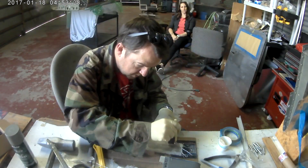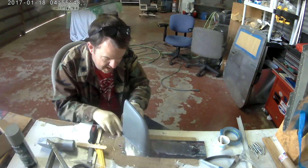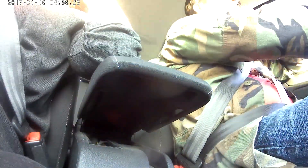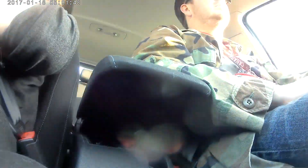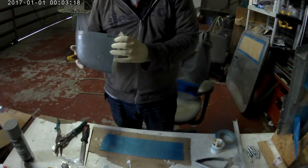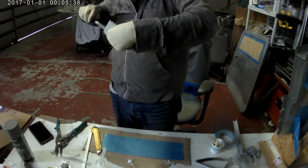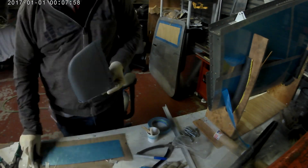After you're done putting that initial piece on and it's bonded to the fairing, you need to reinforce it. On the inside of the piece that we've made, what I've done is made a small piece of fiberglass, soaked it with epoxy, and put it inside the piece. I used a popsicle stick to line it up in the center. When you put that piece inside the fairing, you just have to make sure it's centered and that you've left enough so that it overlaps and goes up the fairing walls just a little bit — about half an inch tops — soaked in epoxy. That will bond with both the piece you've made and the fairing piece itself, and once you've got that connection it's solid.